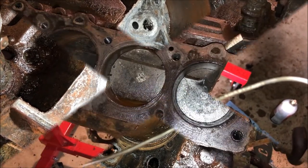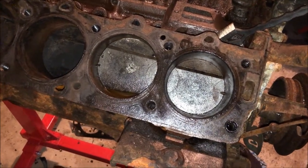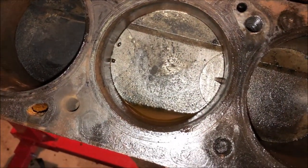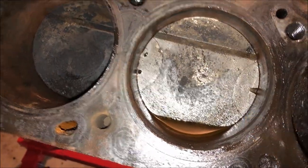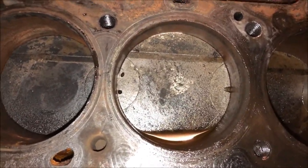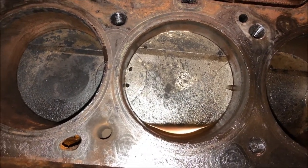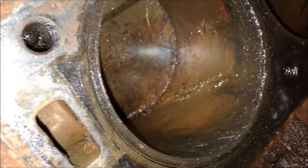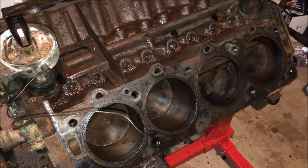After further analysis, it looks like we might have found our two problem cylinders. This one, because it's got that white stuff - aluminum oxide where it comes into contact with steel and galvanically corrodes - and I was told that stuff is, quote, as hard as concrete. And this other one over here has that rust buildup that I'm going to have to try to break loose. Those appear to be our two problem cylinders as of right now.